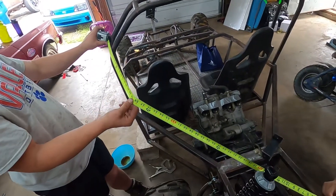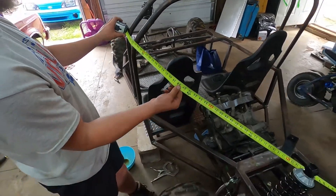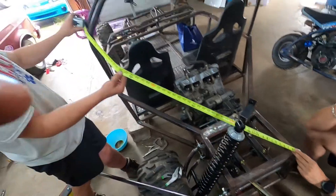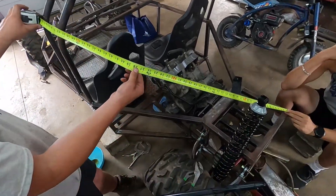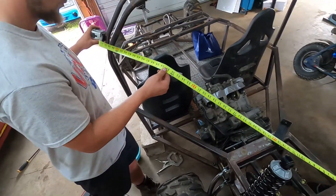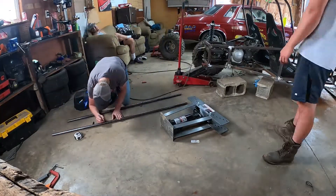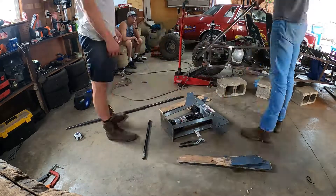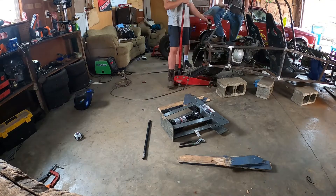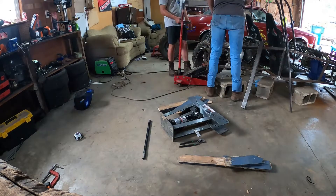All right, complete rethinking of how the rear end is going to work here. Instead of coming out and going straight like we thought, we're going to bring it at kind of an angle — hold it at 38 with the bend at 38, that's kind of what I'm thinking. So it's going to come out like that and cross right here in the back, a little box so the motor's still pullable, and then we'll have a little mount off that cross. Right now we're cutting out about a six-foot-long piece and that's going to be our bend — about four bends on the old Harbor Freighter. Hopefully that works and then I'll see you next time.